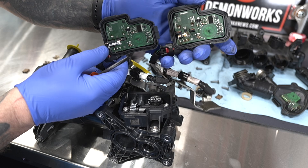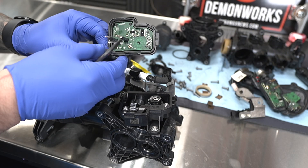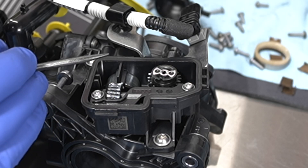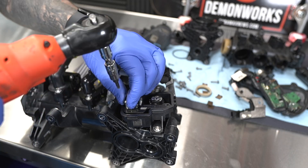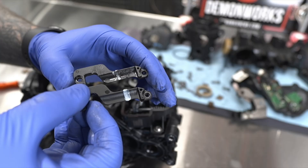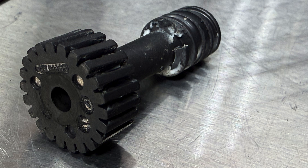All right, so this is the old one right here. Do you see anything different inside there? Let me know in the comments. We got our comparisons there. We can see this gear right here — it is flat still, and it does show grease throughout. That is still plastic. I'll go ahead and take off this cover. We can see the grease — you can see the difference. You can see the grease breakdown from the old one and all the plastic residue versus the new one. Big difference. And here is our old failed gear — not much grease left in there, so that is an issue.